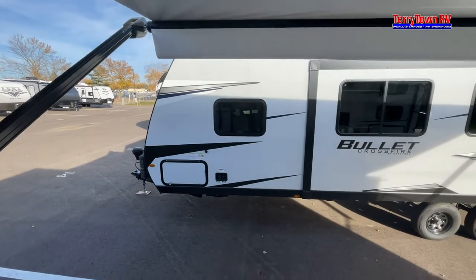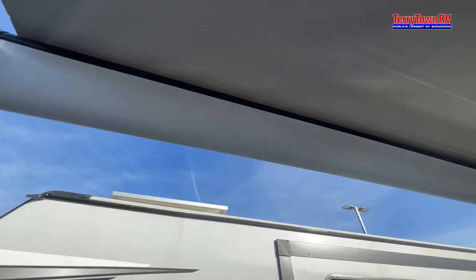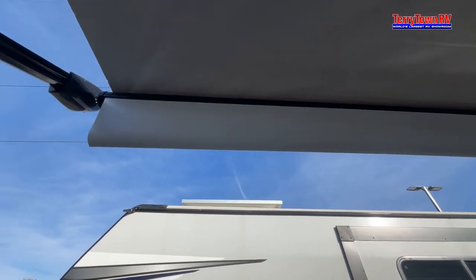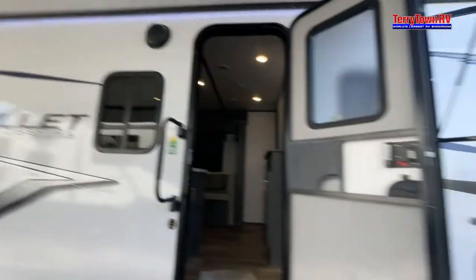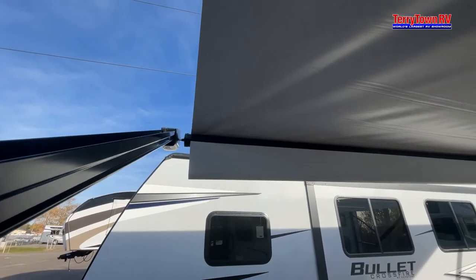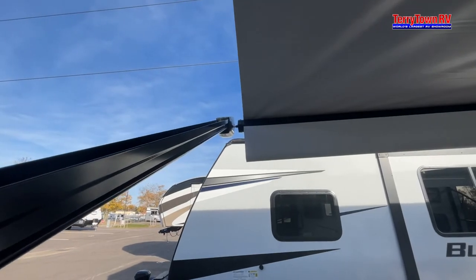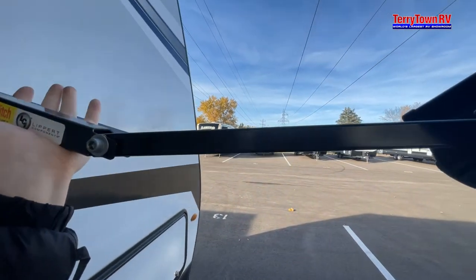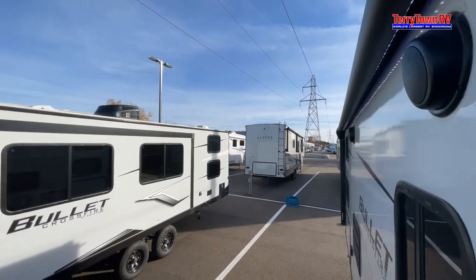That's about perfect. The flap is down and you can see the black bar. You can go out a little bit farther as long as it doesn't start to reel in the opposite way — when it's fully like this you know it's fully extended. Also, to pitch it for rain, pull down and the awning will tilt to let rainwater roll off one side. It claims you can reel it in like this but I just recommend bringing it back up — better safe than sorry.